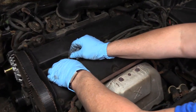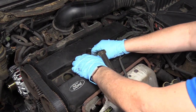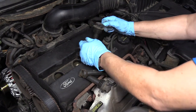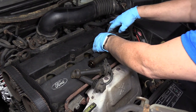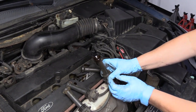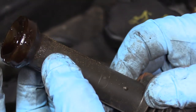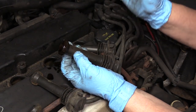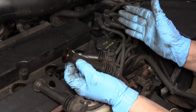Now we're going to remove the spark plug wires — that was pretty easy. Just twist and pull up at the same time. These are all great times to take a good visual of your parts additional to what you're doing. When you see oil like that on your spark plug wires, they need to be replaced, because the petroleum in oil will break things down — it breaks this rubber down — and eventually that spark is going to find its fastest way out, and that's not going to be on the spark plug. It's going to be on the side of this boot, and you're going to have a running condition, a misfire.